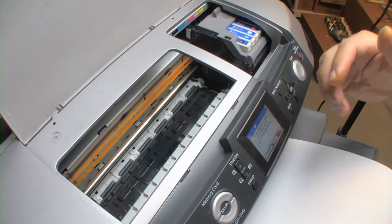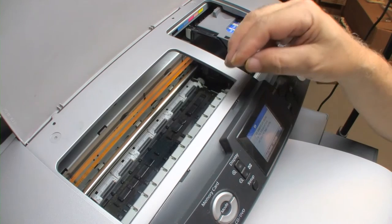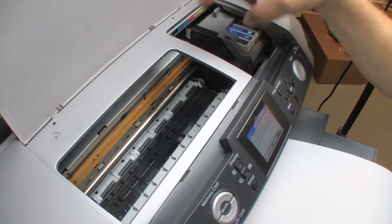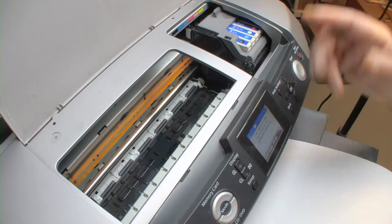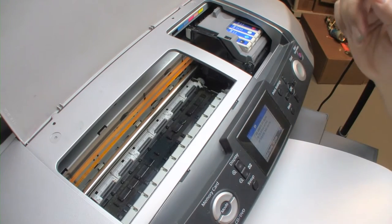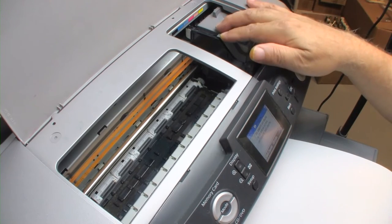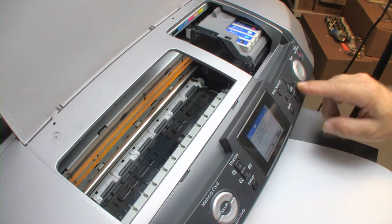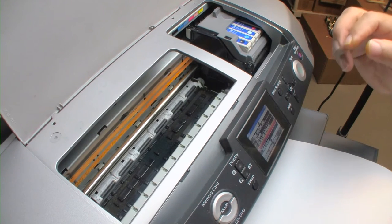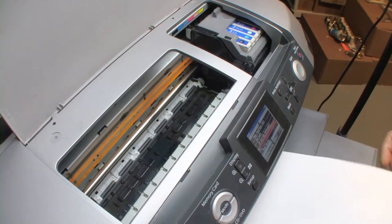You would treat each head until you see nothing but blue Windex coming out of the bottom onto the paper towel — readily visible. Change the toweling until you're getting nothing but blue Windex. At that point, return the carriage to the center position, insert all your cartridges back. The printer will be off — you did the turn-on-then-pull-the-plug trick. Put the plug back in the wall, turn the printer back on, let it do its startup dance, run one head clean to prime those ink stems. It might take a couple of head cleans, then retest with another nozzle check.